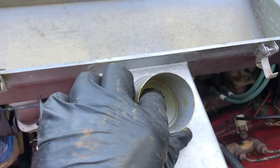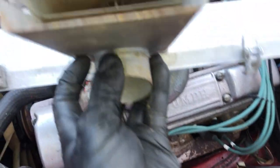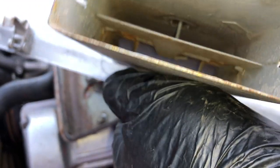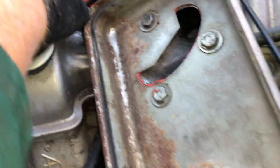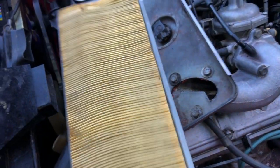And whilst I was just re-putting stuff back together, I noticed on the air filter, I hadn't seen this before, the bottom hose comes up into the air filter box, that actually that is heat controlled. So presumably that flap opens as the temperature gets hotter to let more hot air into the carburetors, which obviously is going to help the airflow and the capacity and the bang, basically. It'll take more fuel and be a better explosion. And it's driven by that little metal pipe you can see on the top there. I think there is some hot gases that come through from the engine via this little neoprene pipe into this top kind of dish here, and they do then adjust the mechanism inside the metal filter box to open up that valve and then let more air in.